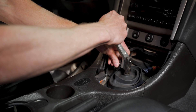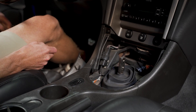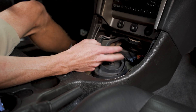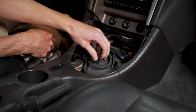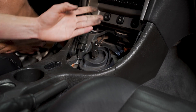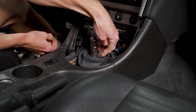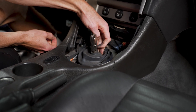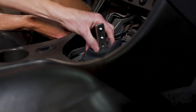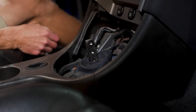Remove the existing handle followed by any isolator or anything that could be on there as well. You can clean that up if you have some corrosion, but ours is in really good shape, so we're going straight on with the factory style shifter handle. There's also another hole down there — most aftermarket shifter levers have some adjustability so you can change the height of the handle, but I'm going to go back into the top two holes.